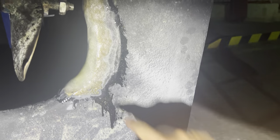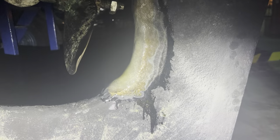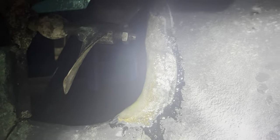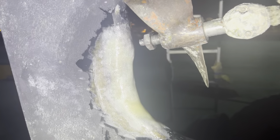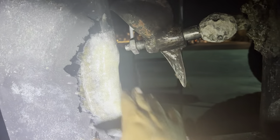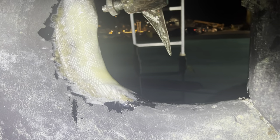I went ahead and smeared some thickened epoxy over the rudder shaft that was exposed, then put a layer of glass on it to smooth it out a little bit. It's pretty lumpy still but it's a lot better than before. I think that'll be an okay repair. To make it perfect I could put some fairing compound and more layers of glass, but for now I think that'll be good - I might do a few more layers of glass later.